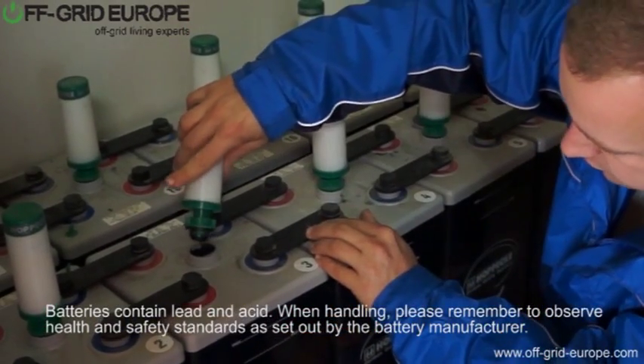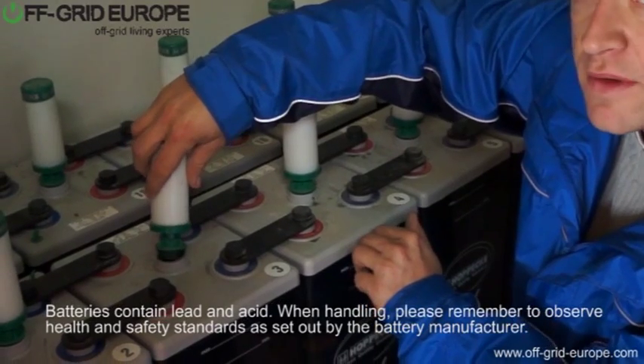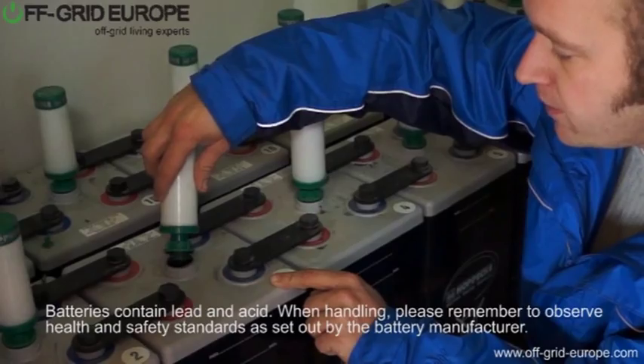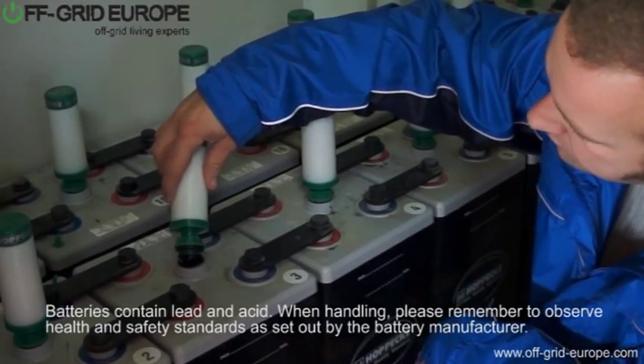You can see when you just took it off, a few drops here — see that falling out? This is distilled water going back in. This is going to reduce the amount of consumption of distilled water by this battery and mean that you don't have to top up this battery that often with distilled water, thereby reducing maintenance of the battery.